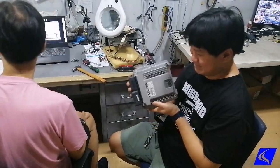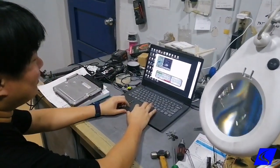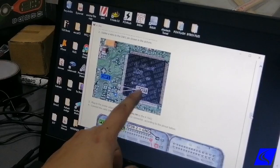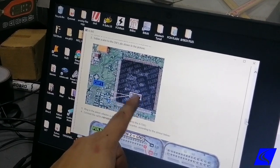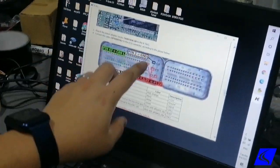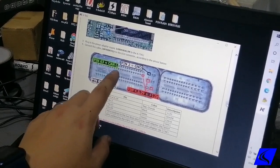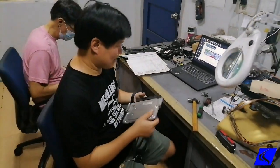We've removed the Veloster ECU — looks like surgery is required. Looking at the diagram, we have to put three pins here where the processor is. There's a label called 'boot' — most computer folks know what this means — this starts up the processor so we're able to read it. A little below, we plug in pins corresponding to another part of the ECU: three connections supplying 12 volts, a ground, and CAN high and CAN low — the actual communication lines for uploading and downloading information. We open this up gingerly and carefully.